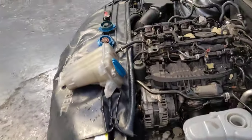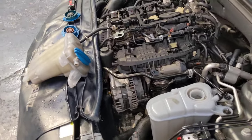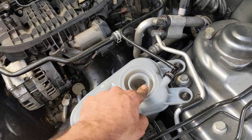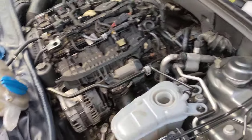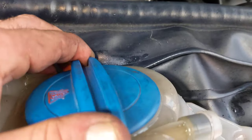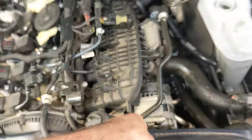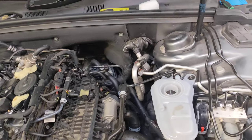You don't want to use a flat screwdriver or you'll actually break the radiator. The book time is 2.8 hours, but in reality the front of the car comes off and there's an intercooler here, so be really careful. With this end of it, this thread somehow changed shape from the overheat event. It was quite noticeable that the cap's rocking around — bear in mind the cap that's rocking around is not the broken one, it's just a spare one. Something's changing the dimensions of these threads, which allows coolant to bypass down there.